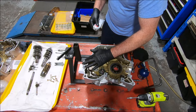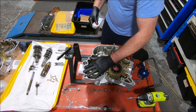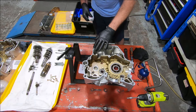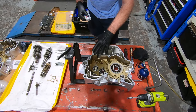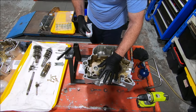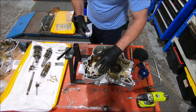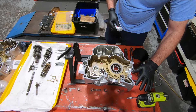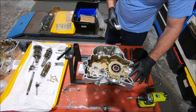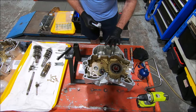A little will also get into the bolt holes to some extent — it's not a big deal. Just keep dabbing away and make sure it's all covered, but not drowning; you get a feel for it over time. The knurled pattern does help retain the sealant, but it wasn't ever really an issue. Put a little bit there and spread it around a bit.